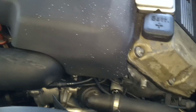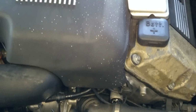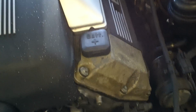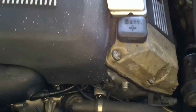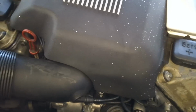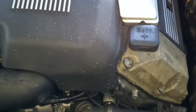Once that is all done and you have the tensioners and everything back in it, the front covers are on, and you have the valve covers still exposed, leave the oiling rail on the intake cam off. Because when you pull that TDC pin out, you're going to want to rotate the motor around, make sure everything's good. Rotate it back until you're back on TDC, put the pin back in the motor. Make sure you don't rotate backwards on this thing. They have the 45-degree mark to make sure that you can only go forward from that point, so you basically want to turn the motor and let that pin slide right in where it needs to go.